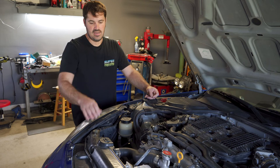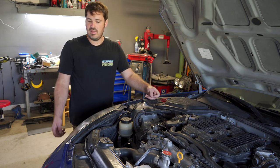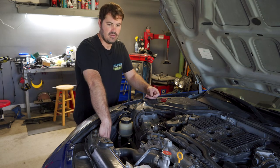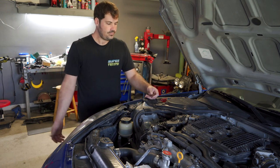I haven't seen any problems with the intake air temps. Like we mentioned in season one when we were testing at the track, it seems to do just fine without that duct through the support — it's drawing cool air from the bumper right next to the radiator, still no issue. On my car I have the original '03 DE rack. The rack is the one piece that you don't have to change, in my opinion. The DE rack doesn't have the electronic variable steering, so to keep things simple it's almost better to just keep that rack.